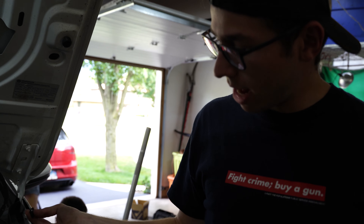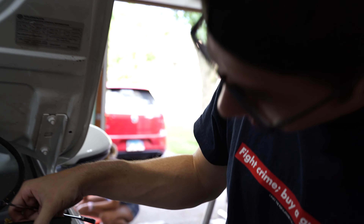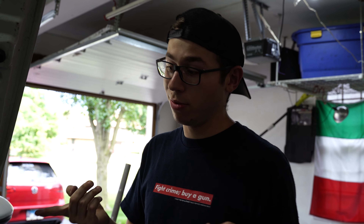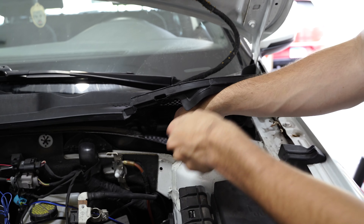So right now we're installing the solenoid. According to the PDF they give you, you remove the weather stripping and there are some little clips — about three of them we removed. You just lift it up, get a 10mm, and right here they give you an included bolt. You take your solenoid — this little thing's already there, nothing attached to it, so it's literally perfect. You ratchet that down, connect your vacuum line there, and you've got your actuator installed. Once that's plugged in, you've got your valved exhaust working.